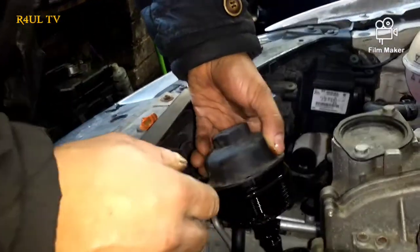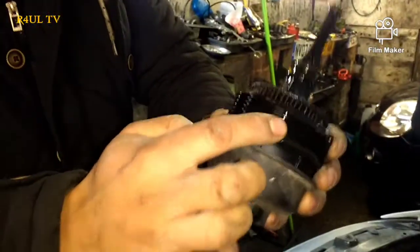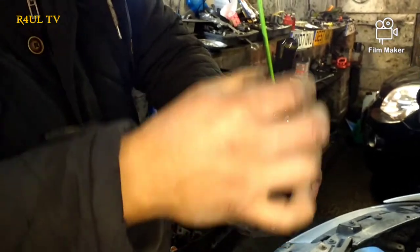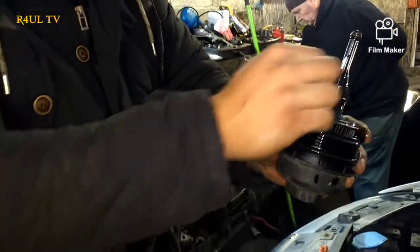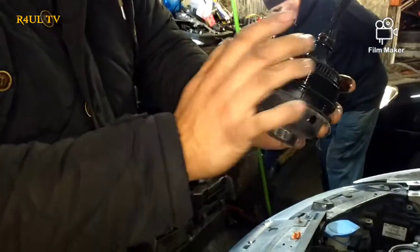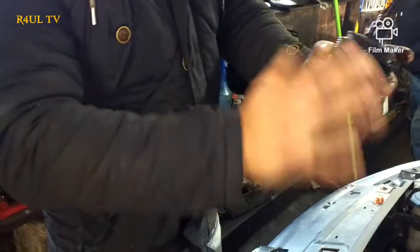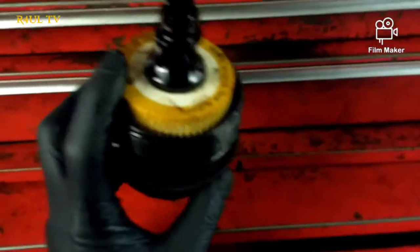As you can see there's hardly any oil in there because it is a downward-facing one, but just in case. And there we have it — one oil filter off. What we do is put a new one on. Make sure you change the rubber ring; the smaller ones you don't really have to if they don't come with it. When you get the new oil filter, check the package — if it's got all three seals, replace all three; if it's just got the one, just replace the one.